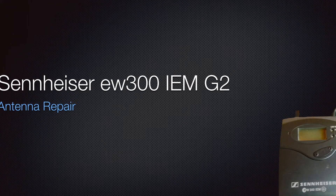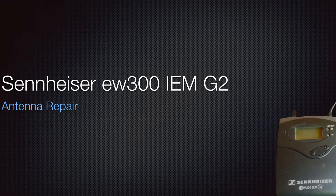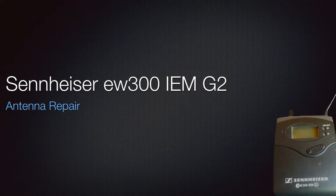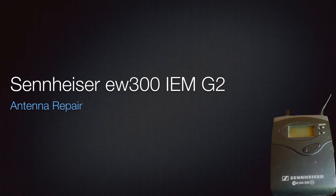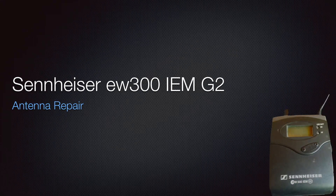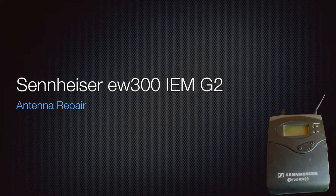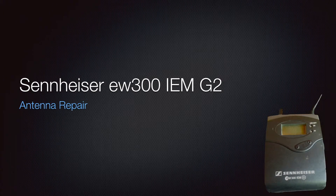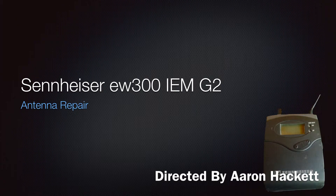I have a second body pack, and to fix it — as I'll show you in the next picture — the antenna hadn't totally broken off. It was just the rubber grommet that was torn. So I got some shrink wrap and shrunk that around the grommet and the antenna, and put a little piece of stiff wire in there to stabilize it. It was still a bit more flexible than I wanted, so I ended up using some hot glue around it. The hot glue is not completely rigid where it would crack like JB Weld would, and it gives a little flexibility since it's sitting up against your body and will move around.